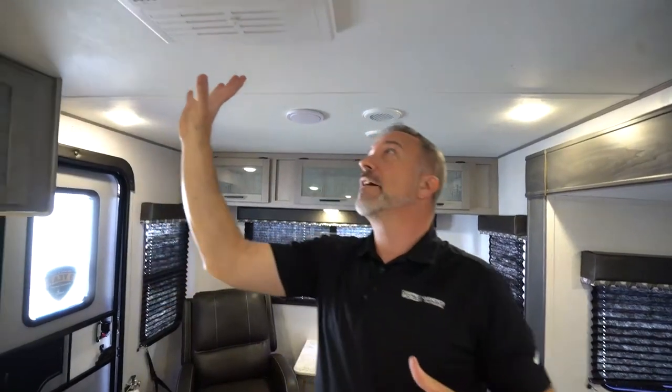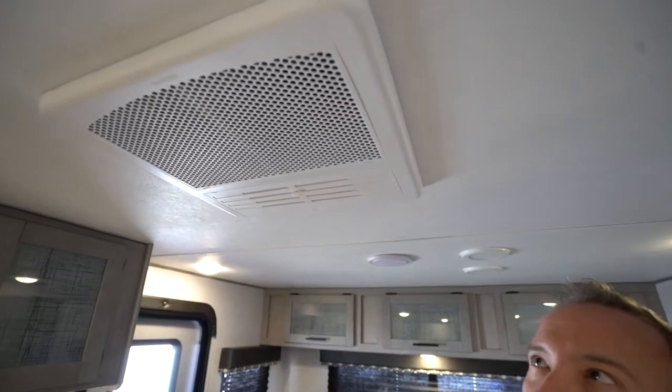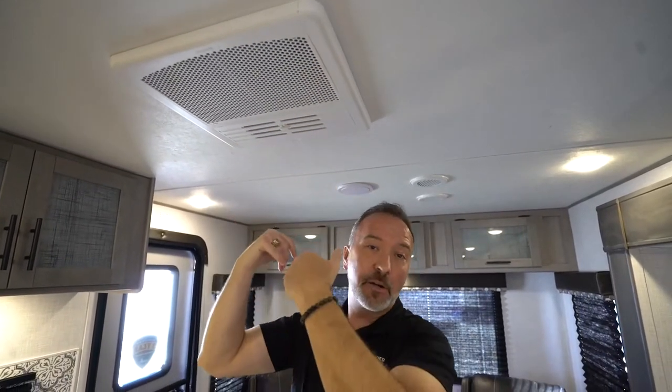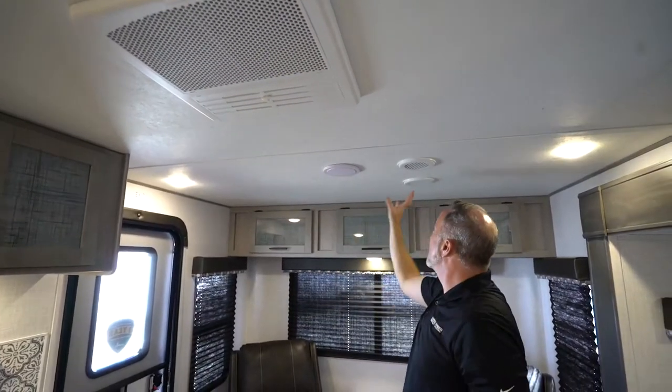Your travel trailer will feature high ceilings, entertainment systems, air conditioning, and HVAC heating systems. You could have Dometic, GE, or Suburban — either 13,500 or 15,000 BTUs. Your travel trailer could have one AC or two ACs if it's 50 amp service. You'll have a quick cool dump on the rear or the sides that allows air to come out quickly to cool you down. Close it and the air will be ducted through the ducting system on the roof.